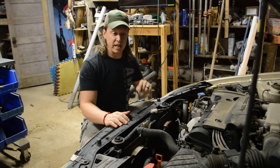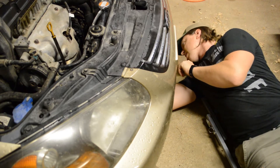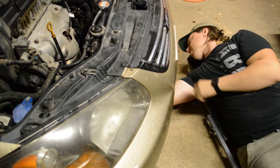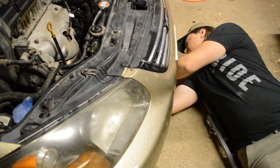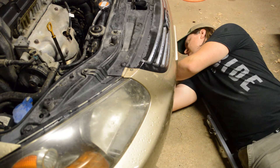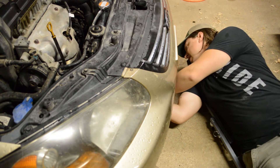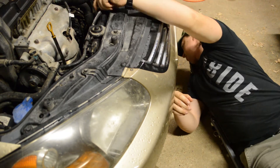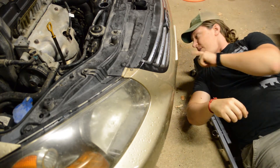Let's go ahead and get this radiator draining down so we can start taking it apart. This radiator has a drain plug on the driver's side that takes a Phillips head screwdriver. We're just going to put our screwdriver up in there and get this thing moving. We'll put our pan directly under it and see how much of the coolant we can catch — you're not going to catch all of it, but draining from the bottom of the radiator makes this a lot easier. There's the plug. Put that on our parts table and open up the cap to get it draining.